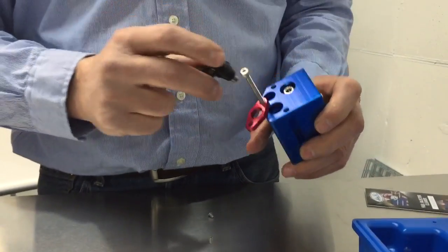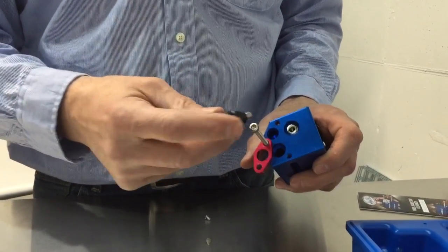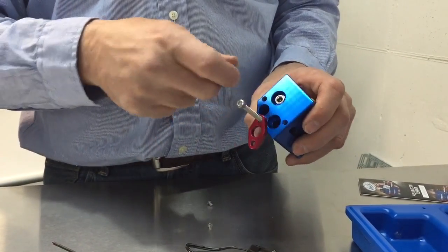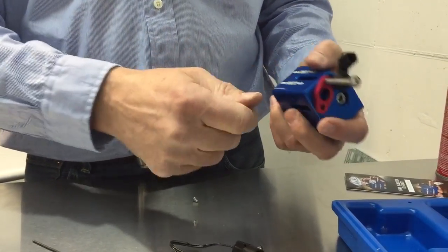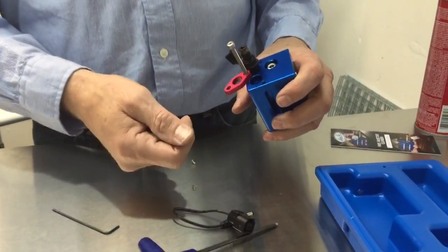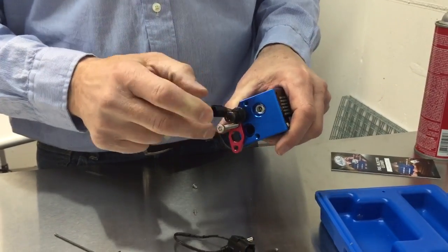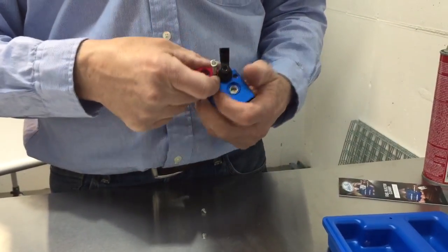And then this is a HYB injector, which is what KTMs use. If you're using this for a different brand, like an ND injector on one of the Japanese bikes, then it might take this other hole. So there's 2 holes here for doing this. It says on the side here, port 1 and port 2, and you determine which one to use by just what hole it fits in. So this side is way too big, this side it fits nice, and be careful with these things because these are just plastic bodies, so don't be cranking on them much.